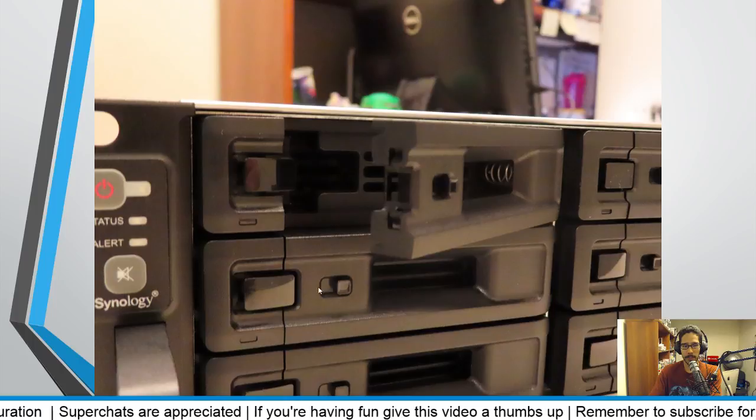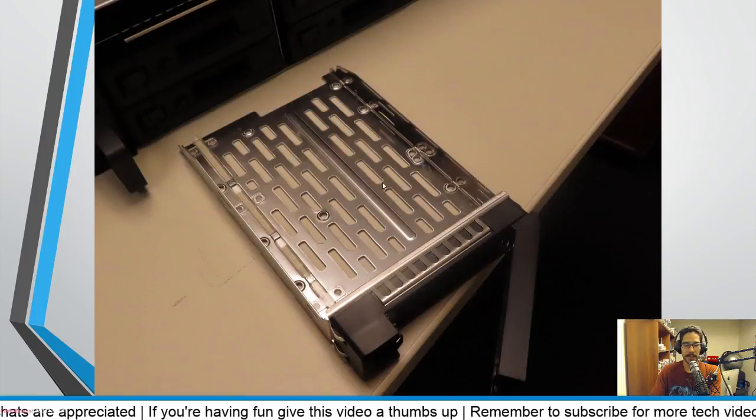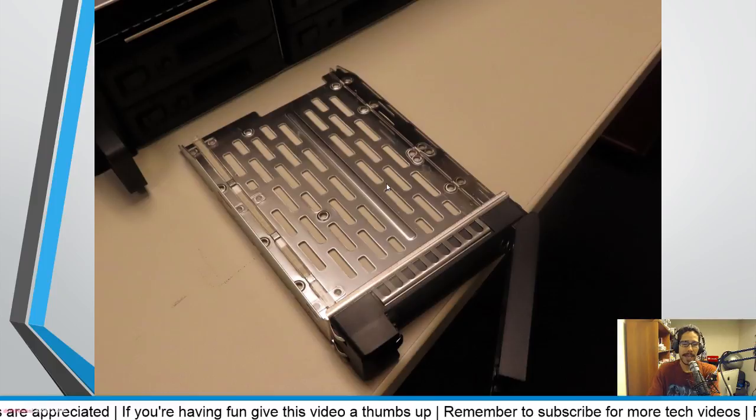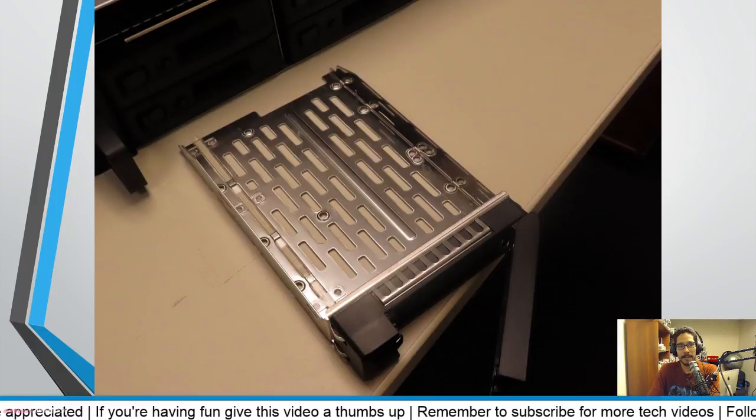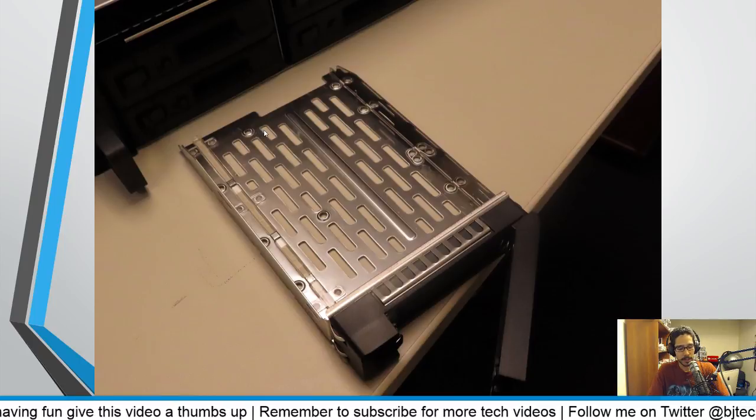And when you press this little button right here, it kind of ejects the little handle. This is the spring, and this is one of the cradles. And I want to thank a viewer out there, because they said you don't have to purchase the cradles. You could fit a 2.5 solid state drive here. So these little slots right here are for your solid state drive.